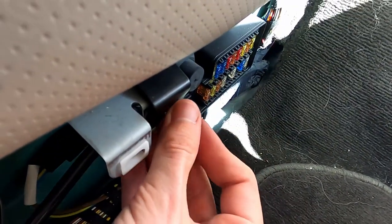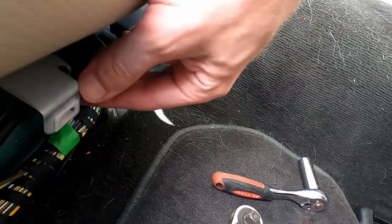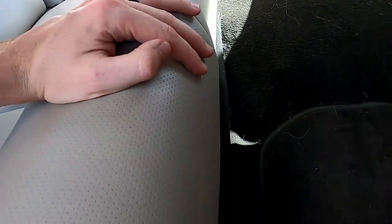There's your torx bolt from earlier. Get that threaded in — I've already got the one on the other side threaded in. I'll get those tightened up and then put these panels back in to cover the wiring and fuses. The footwell covers go in super easy — literally just slide in and thump with your fist to get them seated top and bottom. Make sure the tunnel sits over the top and under the seat, and then you have your one little plastic plug on both sides. That took about 30 seconds.